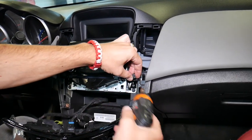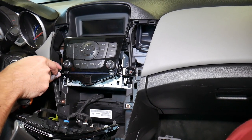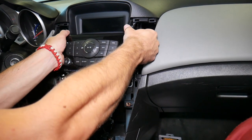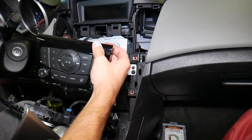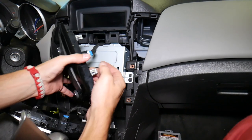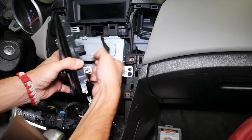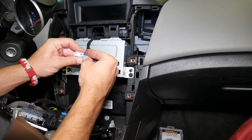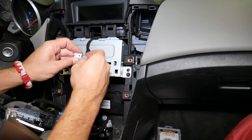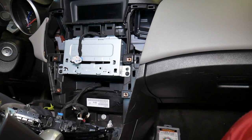You can see this is the screw I'm removing here, and then one more. The radio controls come up — you have two clips right here; grab it and pull it out. Right here the connector has a blue retainer clip that prevents it from getting loose. Pull it out, press in here, and disconnect it. I'll try to reinstall it so we won't lose it like we did last time.